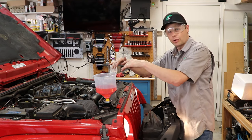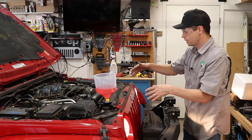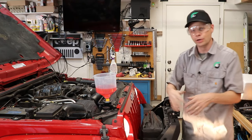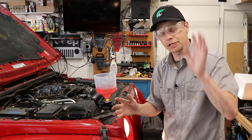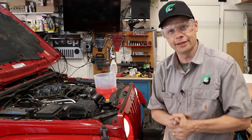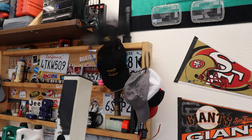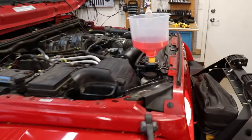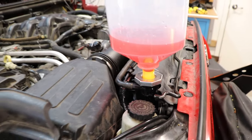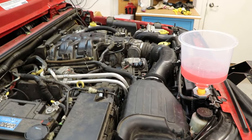This funnel fill kit — if you don't have one of these, it's so handy in burping this system. Get yourself one of these along with that thermostat. I will link both in the description below. Thank you guys so much for watching, I really appreciate your support. Check out my next video right up here and have a good day. It's been a good 10 minutes or so and I'm still getting some bubbles — be sure to purge your system really well. You want to get all those air bubbles out so you don't get any hot spots.